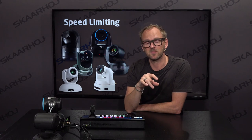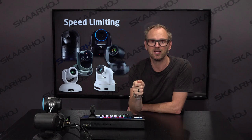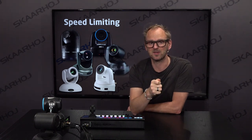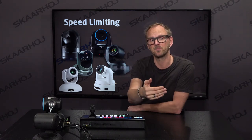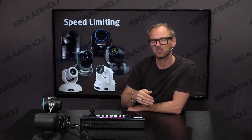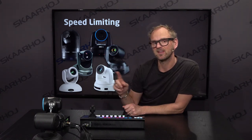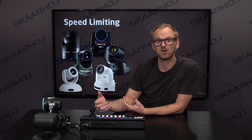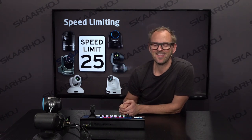Panasonic cameras are quite clever because when you zoom really far in, they interpret the speed steps sent for pan and tilt differently than when you're on a wide shot. It's built into the camera to compensate for the focal length of your shot. On a VISCA camera like this, you generally don't see that compensation, and in that moment you begin to interest yourself in how the controller can support you — which is why we implemented a speed limitation in our controllers.